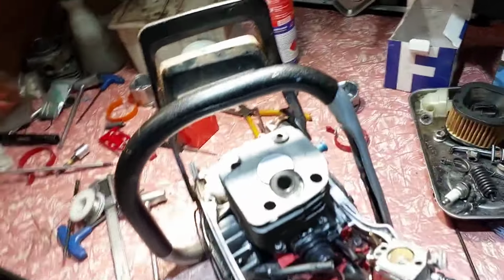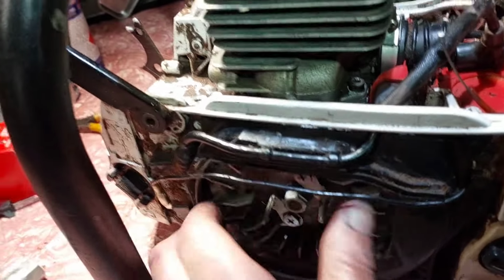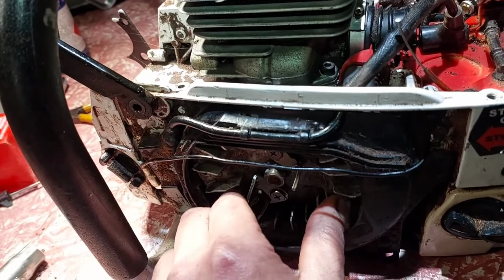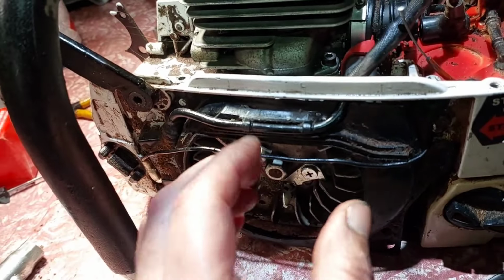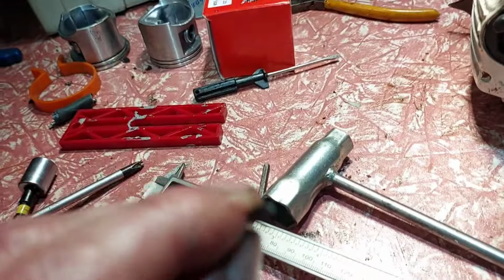Get it back together. It's still not perfect, but way better than what it was, so I can turn her over. Wrong way. Turn her over. Bit stiff at the very bottom end like that. But it was running before even stiffer than that, so they should loosen up. The metal's bent in a bit, so I've got room to expand back to where it should be. So that should be alright. And I've got 20 thou squish, so it's pretty thin.